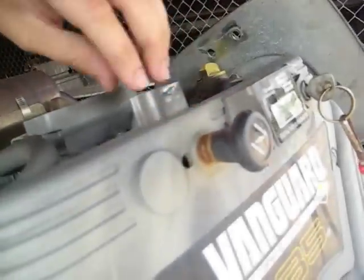You're showing pictures of these linkages right here, which are hooked into all the springs and everything. The actual linkage that we're talking about, you watching, is this one right here. Right now, you can see this is the idle set screw. You can access it from the front side of the motor. So that's how you turn up your RPMs at idle. And that screw, you can see, is pushed out a little bit. It's kind of blurry, but you can see it's pushed out, but this thing puts pressure against it to keep the idle at a certain RPM.